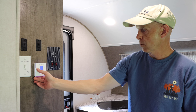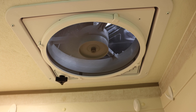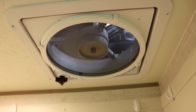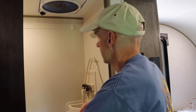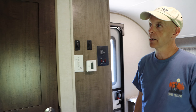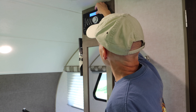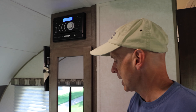Check that all overhead LED lights go off and on — they should work perfectly on battery without being plugged into shore power. The stereo should also run on battery power and show a lit display. Those are the main elements that are supposed to work on battery — that completes the check of the DC circuitry.